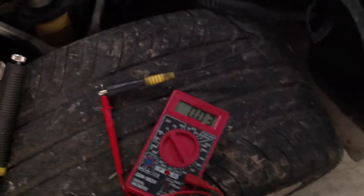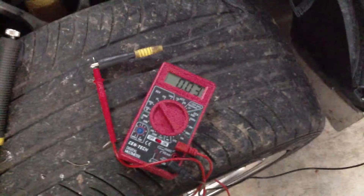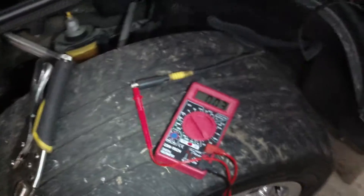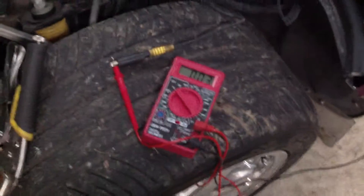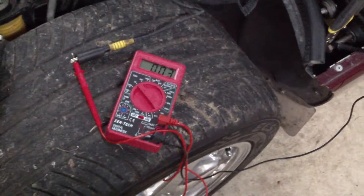The reading right now — you can see that's 30 milliamps. That's fully acceptable. Any vehicle that's computer controlled, if it's under 50 milliamps, I would consider it acceptable. My positive lead is connected to the battery negative cable, and my negative lead is connected to the battery negative post. That's the correct way to do this. Older vehicles go to sleep pretty much right away. This one's sleeping — 30 milliamps. That's completely acceptable.